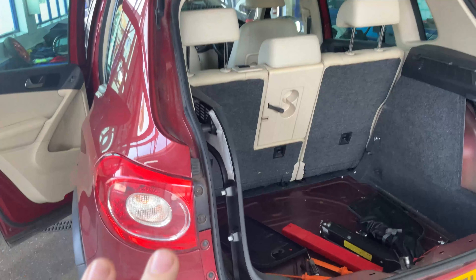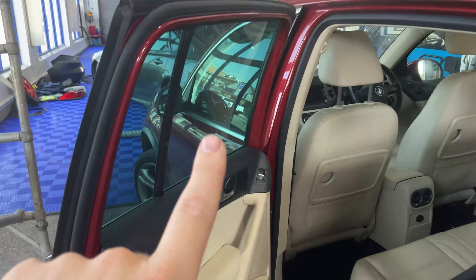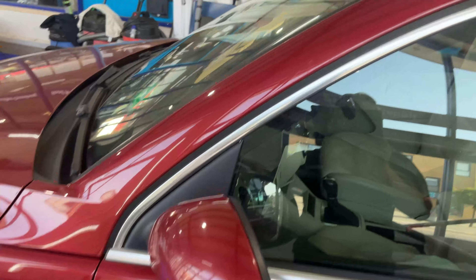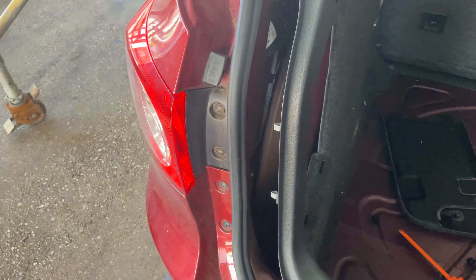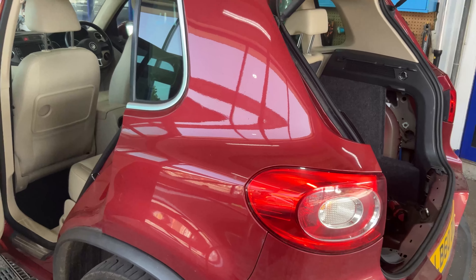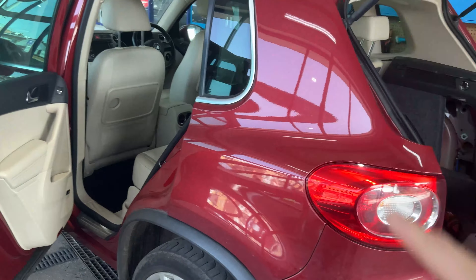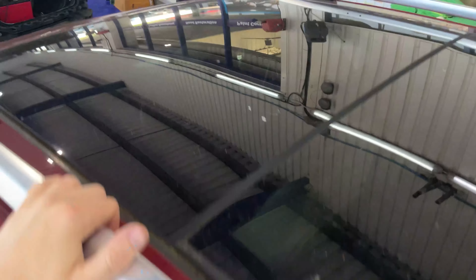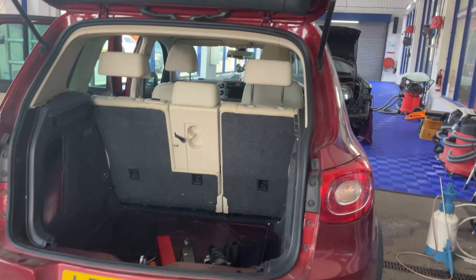What we recommend is all four of the sunroof pipes to be swapped out. If the back two have shrunk due to age, the front ones will be the same age, so although they're not showing signs of leaking at the moment, as a precautionary measure we'd suggest swapping those out too. We're also doing a modification on the grommets — they're like an X-shape — and we modify those so they can run a little bit more freely, because any debris or dirt from the sunroof can block them up quite quickly, which is another common issue. We'd also dry the interior of the car out and clean out the scuttle area, as there's quite a lot of green algae along there. I'll put that all in an estimate — if you're happy with that, let us know and we'll go from there.